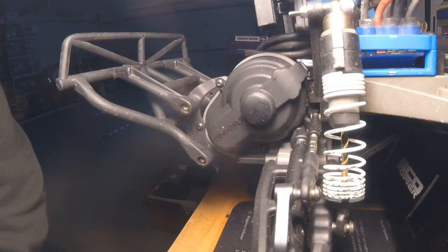Being bored in the wintertime with nothing better to do, I did try and mess with the gears a little bit. I dropped the spur down to an 83 tooth and bumped the pinion up to a 23 tooth, then drove it on a 2S battery. It's an old battery — only got a 50C rating on it for discharge — and the tires were extremely worn, basically bald. So the results I got were about 33 miles an hour, which is definitely not impressive for a speed run. I was just purely curious, not trying to break any records.